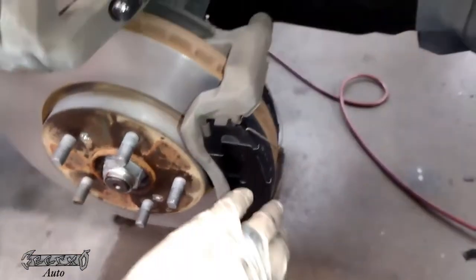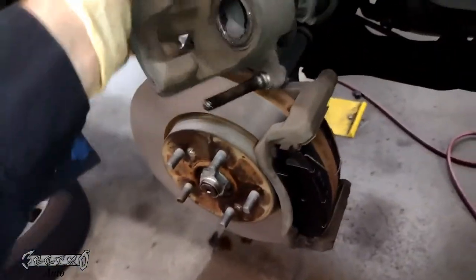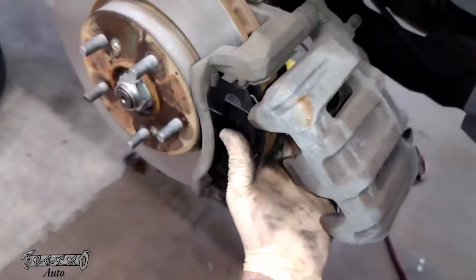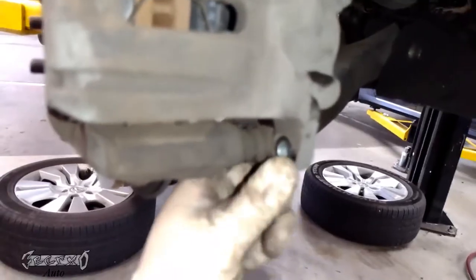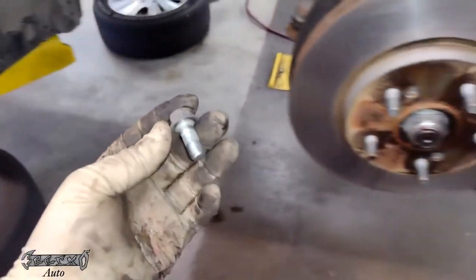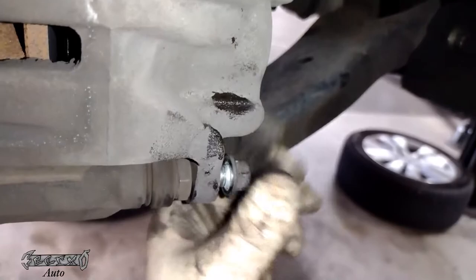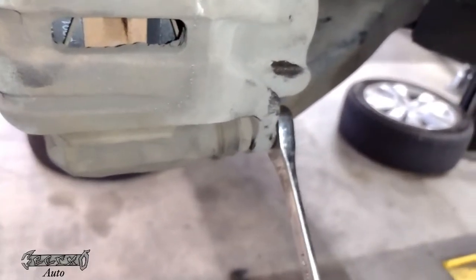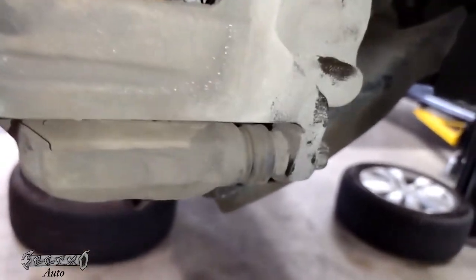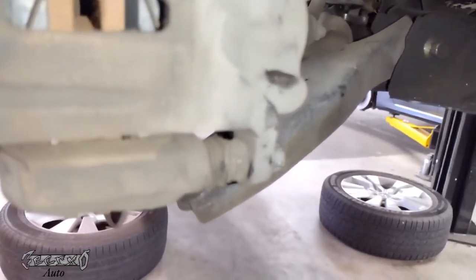Lube the pin there, and then we'll put these little springs back in. If your springs are good, they're going to try to push the pads out of the whole bracket, so you need to hold them. Once you put the springs in, hold the pads and with your other hand put the caliper over the pads like this. Basically, you squeeze the pads and let the brake caliper come down. You can push the little caliper pin in to make room and it'll come down. Put the 14 millimeter caliper bolt in on the bottom. When tightening, if the inside spins, use pliers or a wrench to hold that little nut — guys sometimes think it's tight but it's really not.